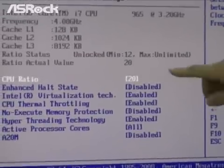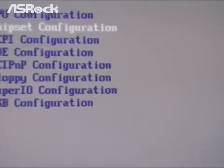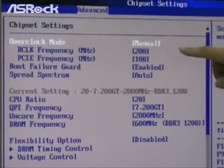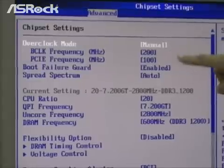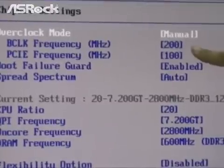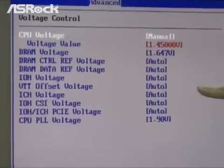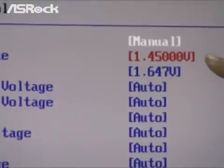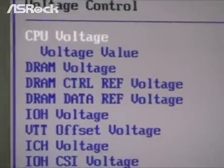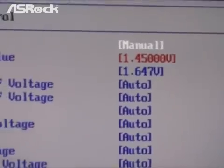Although this is an easy way to overclock, it still involves many fine-tuned technical specs. For example, when you enable Easy Overclocking, some energy-saving functions of the CPU will be disabled. The CPU ratio will be set to 20 when B-clock is 180 to 200, which means the CPU operates from 3.6GHz to 4GHz. The key voltages are auto-preset, and so are the memory timing and voltages.